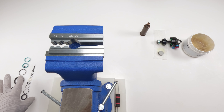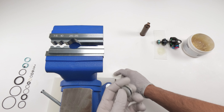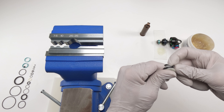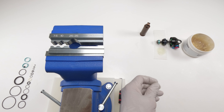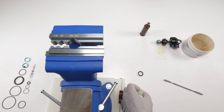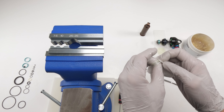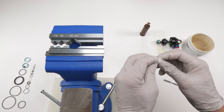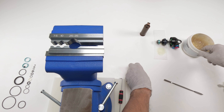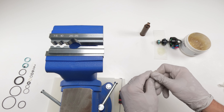Leave the IFP in for now. Grab a cloth, dig in there all the way to the bottom, and make sure the inside is nice and clean — threads too. We inspect for scratches, rubbing, and abrasions. This one is perfectly clear and in really good shape. To work on the IFP, we're going to need the seals from seal kit 803-00-816, which I've opened and ordered by size to make finding the right O-rings easier.